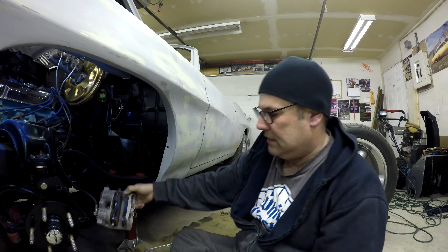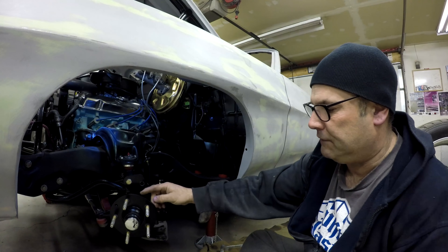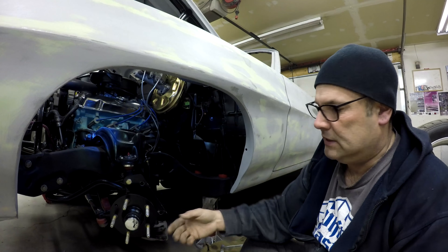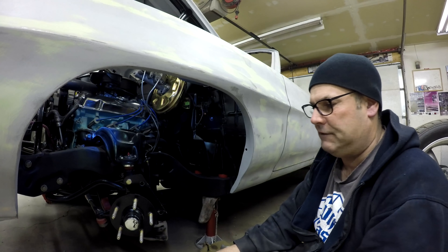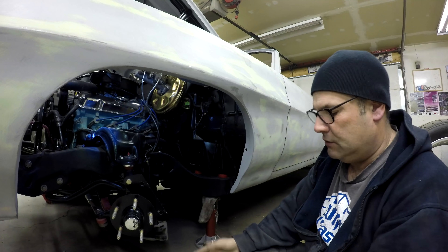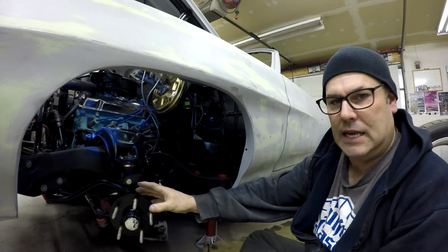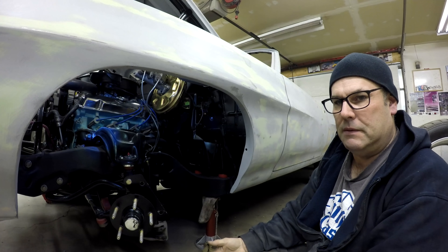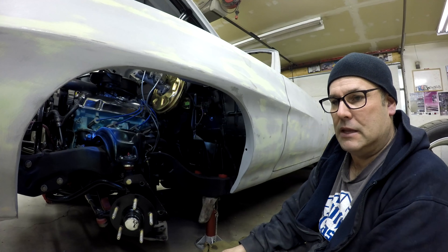The Corvette caliper is a dual piston — I think they look pretty cool — but the Camaro one is bigger, so if you wanted that bigger look to fill the wheel well better, you might want to go with those. They're also easier to find than these Corvette parts. To put the Camaro rotor on this hub, you have to turn it down a little bit — you can just use a flap wheel and keep test-fitting the rotor until it fits, without taking it to a machine shop. Then you make a cardboard template or purchase one from various places online; I'll get Mike to put links in the description.